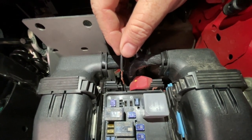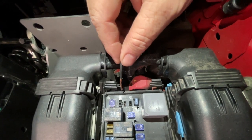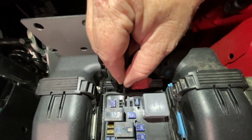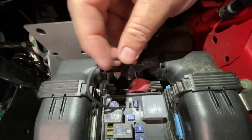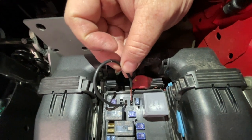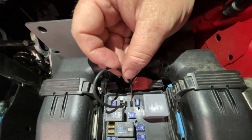You need to make sure that the car's ignition is turned on, the handbrake is on, and the car is in park, because the car will start up regardless of what gear it is in, and you don't want it to move forward. Once we bridge these, the starter motor will be engaged, so you will need to disconnect it once the engine starts.